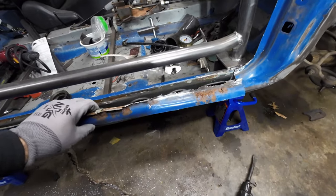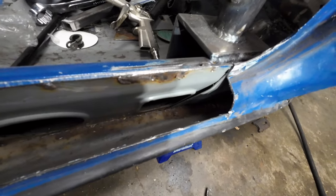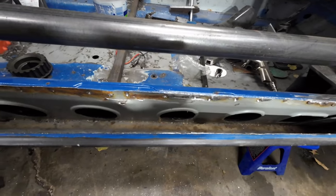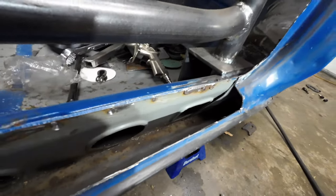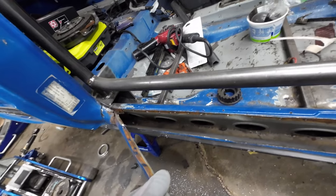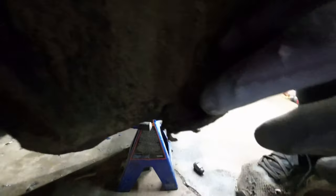There's a little bit more drilling to do, then I can separate the top layer. It looks pretty healthy underneath — other than some surface rust on the bottom, but I'll take care of that. I'm gonna clean that up using my rust inhibitor, and use my air gun to blow everything out. That stuff I use actually neutralizes any rust on contact. There's a little cap here that you just pull out, get the air gun in, and push everything out.